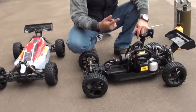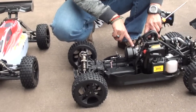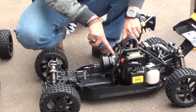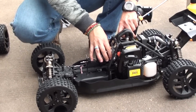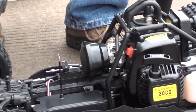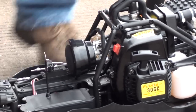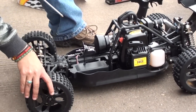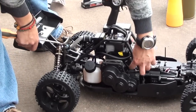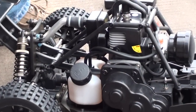What I'm gonna do is just start it and leave it without tuning anything, because normally the engines are tuned already. So first thing is push the pump to get the fuel inside the engine. Then find the choke — here it is — put it up, and pull the starter.